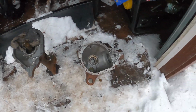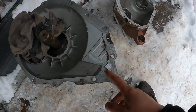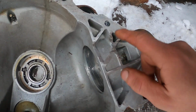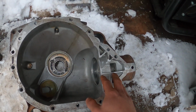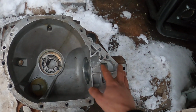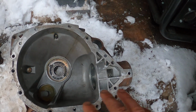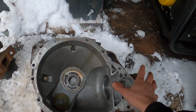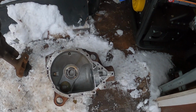So what happened was, and this needs to be explained so you guys can understand it. When you put a thick cut gear in these IFS front rear ends, you have these oil journals to feed your main pinion bearing. And as you can see, this one here, we hacked at it a bit, but we didn't use this front rear end, because Rick knows I use my truck and I use it hard. This front piece had taken a lot of heat from the bearing failure, so he used my other spare rear end, and this here is now just another piece if I actually need it. It is still good, but again, the front end of it took a lot of heat, so he didn't want to use it. So I had no issue with that.